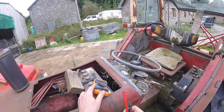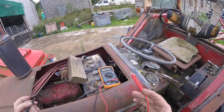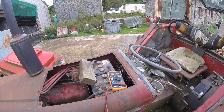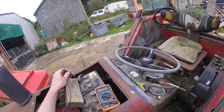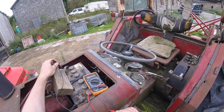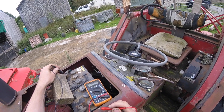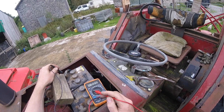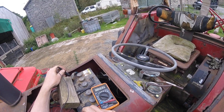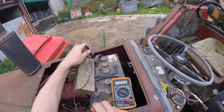So this time, instead of trying to find the earth, we're going to find the positive. It's very easy. Do exactly the same as I showed you before — get it earthed correctly. So we've got the positive here. You imagine now you're touching those wires like I showed you to do with the earth, but this time you've got it on the voltage setting. We're measuring 12 volts, so it goes up to 20 there. That should be 12 volts.